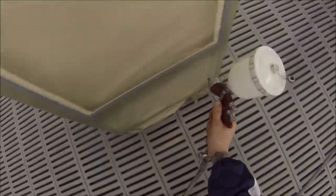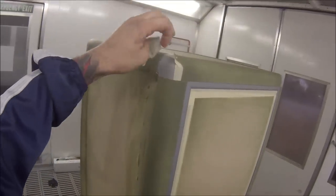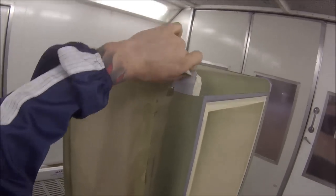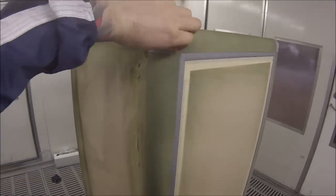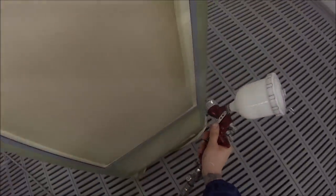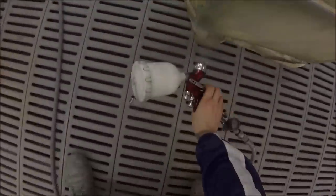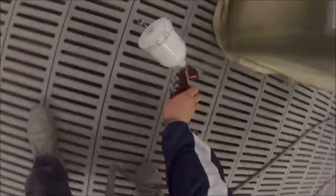PercoTop Coat is the name of the paint, and the brand is Dupont. That's a 2-to-1 ratio. I've found sometimes it can be a little bit trickier to make them yourself with the satin and the matte finishes. I've found this Dupont range has a really good couple of gloss levels. You've got a matte finish and a satin finish, and they always come out nice and clean.